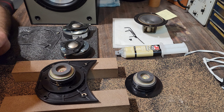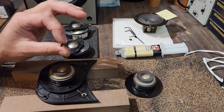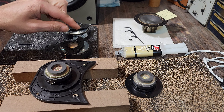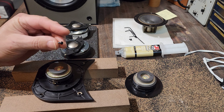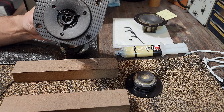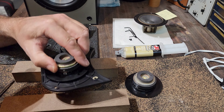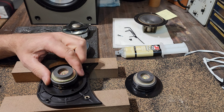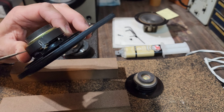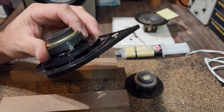Although the plastic bonder will probably prevent them from ever separating, I'm going to use larger screws instead of the factory screw, which is now not big enough — because remember, we didn't have this extra layer of plastic here. I've gone ahead and painted the heads of them black so we can pop that in, put a washer on the back as well as a nut, and give it that factory-type appearance. The glue or resin just went along the bead. If I flip this up, you'll see maybe a tiny bit of glue — very hard to see, and that's a good thing.